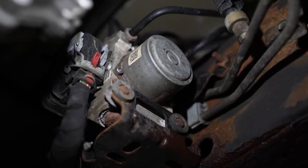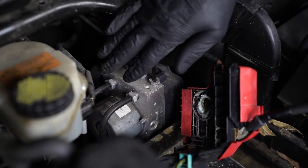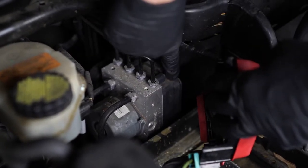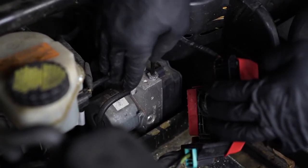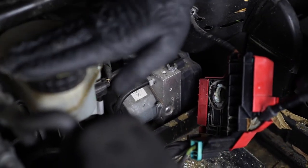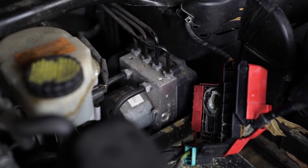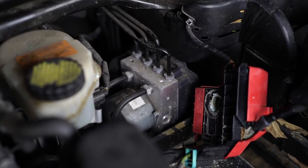That's the hydraulic brake system pumping itself so the wheels don't lock up, allowing you to stop faster and prevent accidents. The system is made up of a few different parts. Right here we have your ABS module and computer. This black plastic part is the computer, and inside is the modulator valves. This right here is the motor — it takes fluid from your master cylinder into this motor and pumps it back through the lines. The valves inside modulate and cause that pulsation in the brake pedal to stop you at a safe distance.